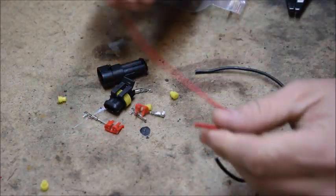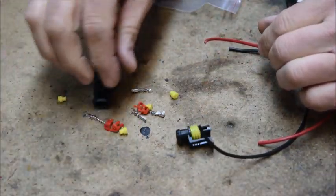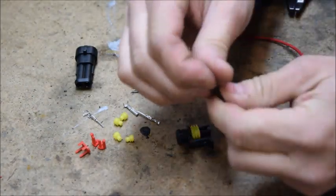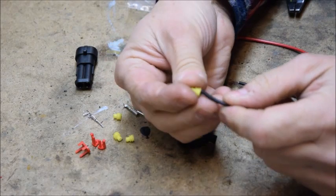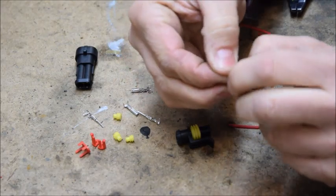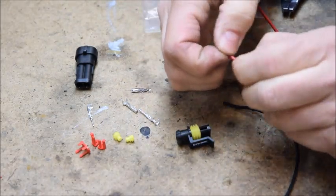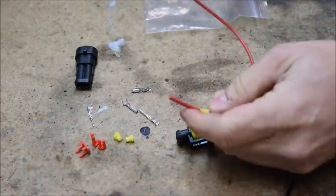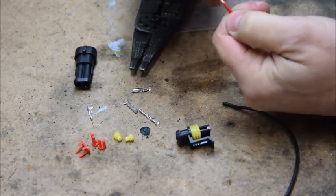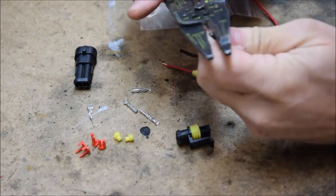The first part of the project is assembling the two-pin connector. In the kit you get a bunch of pins, a couple of locking clips, and four seals. The first thing you want to do before you strip your wire is to insert the seals onto the wires — just slide them on both wires. This is what gets entered into the connector. Then strip just a bit off the wire — this is 16 gauge wire, so about 3/16 of an inch.